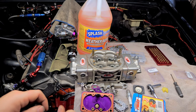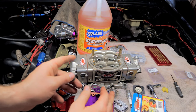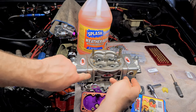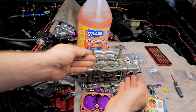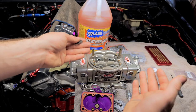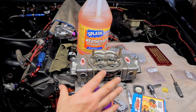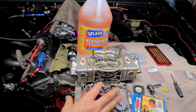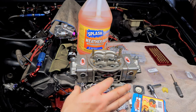So you've done that, you're now making full pulls, and say it goes a little bit lean, a little bit rich, like 11.5. So then you're probably going to go about three or four sizes down on both sides. Or if it's too lean, you're gonna go about three or four sizes up, depending on how it's acting on your wideband. Remember, the wideband is just a tool. You want to use that to make sure that you're not going to hurt anything. So you want to get everything in a nice, happy 12.5 AFR range, right?